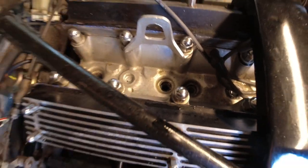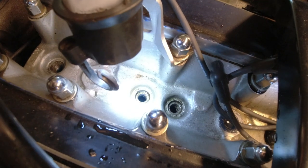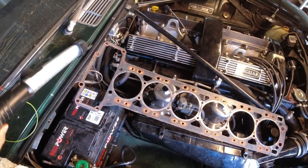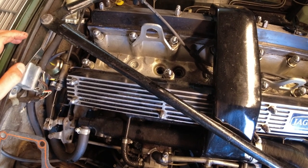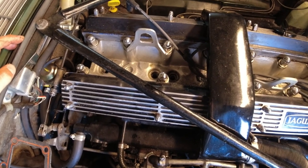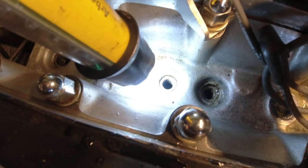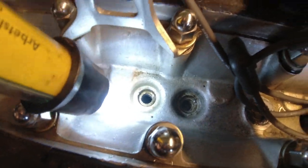Let's check on the pressure and see if we can actually see anything down in cylinder two. I am not seeing anything like before — so that's good. The leak is probably not that big. That large amount before was probably from it sitting for a couple of weeks after I last warmed it up. It's been about 15 minutes now and it's definitely not like before — before it was really covering the top of the piston, now it's just a tiny bit on the side. The leak is there, but it's definitely not as massive as I thought.